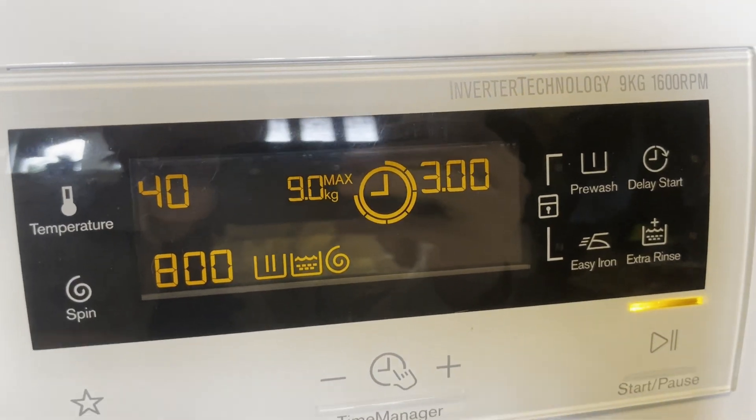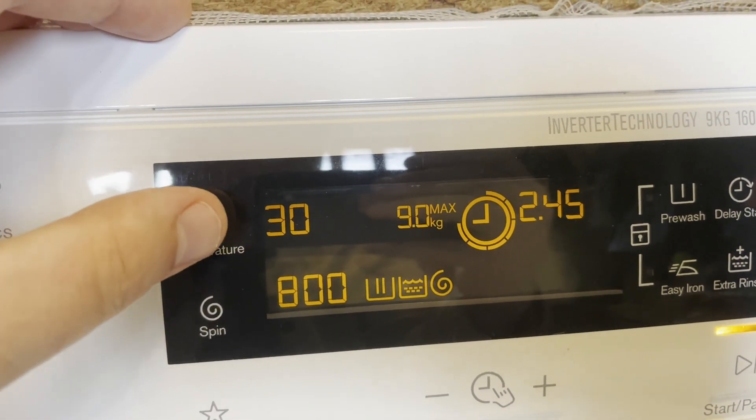This setting is made essentially for clothes that are prone to color bleeding. How it works is that the washing machine uses a pretty low temperature — optimally below 20 degrees Celsius, though you can increase it up to 30 or 40 degrees. Try to stay below 20 because above that, color bleeding generally becomes a problem. This cycle also rinses with cold water and uses an extra rinse to get out all the remaining dye that may have come out from the clothes during the wash.